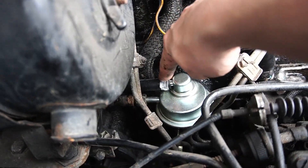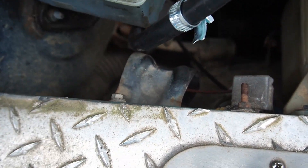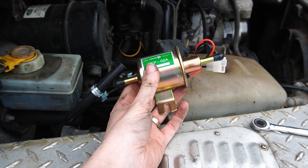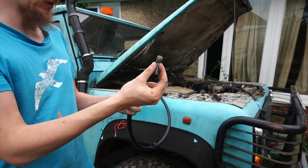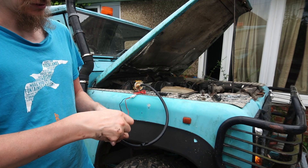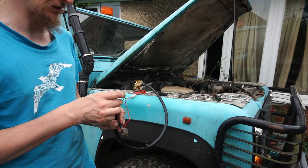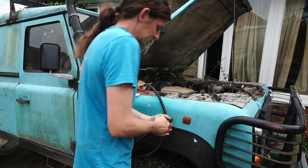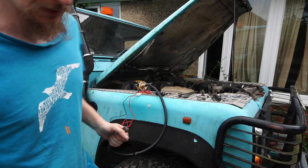We've got a flexi pipe on this end now that comes all the way around to here, above this bracket - which is what we're going to mount the pump to. Really simple: in and out - we're going to stick this on here, mount the pump, and see if it works. To connect this to the fuel filter, use this banjo nut. I've cut the old fuel line and it fits inside here, so we're going to leave a little bit on there to help with the fuel connection, because this stub is very short inside. That way it's going to seal a lot better because it's a lot tighter.